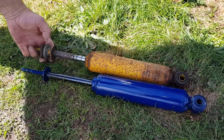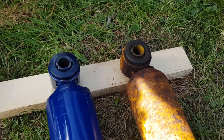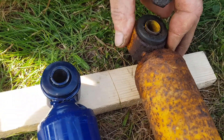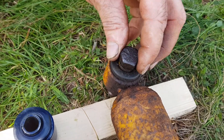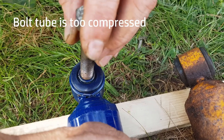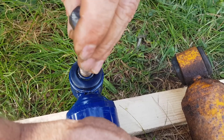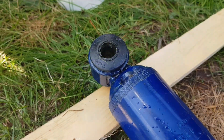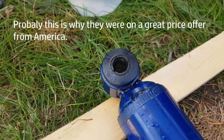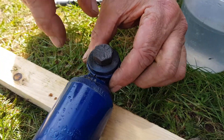It's just the bushes that you need — we've got new bushes. That's not straightforward, is it? Show them the problem Rob. So that's the lower fixing bolt for the old one, which works perfectly, straight through. And then on the new one it needs shaving. So we've got to take about half a mil off that or change the collars over — it's probably easy to just drill it out. Okay, we've just drilled that out a little bit, half a mil. See, from there it fits perfectly. Let's get it fitted.